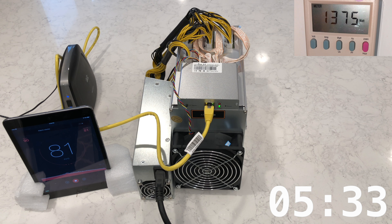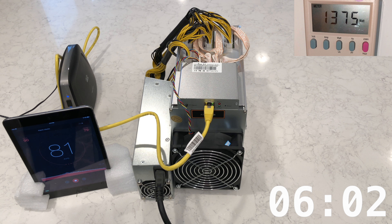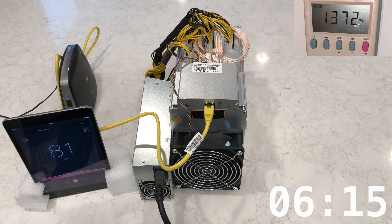After running for a few minutes, I think it's safe to say that the Antminer A3 is just as annoying as every other Antminer. Seeing the power usage at 1,375 watts is a bit concerning, especially since the advertised draw was supposed to be around 1,275 watts. The 1,375 watts it's currently using is beyond the 1,200-watt limit of the APW3++ on a 120-volt circuit — I cannot recommend doing this long term. It's not uncommon for people to lose hashing boards due to the power source being unable to keep up with the demand. Even worse, it could cause a fire. At 1,375 watts on a 120-volt circuit, the A3 needs 11.45 amps, meaning you cannot run more than one A3 per 15-amp circuit, just like the S9 or D3 miners.